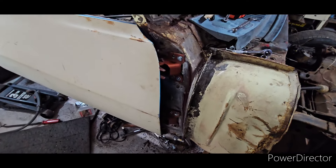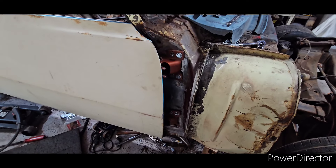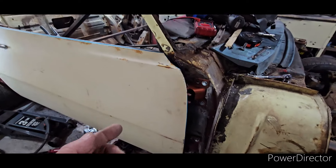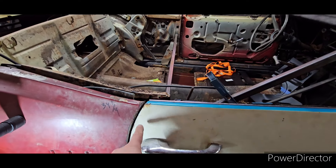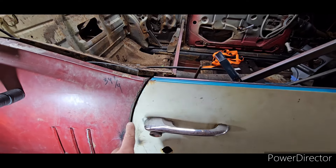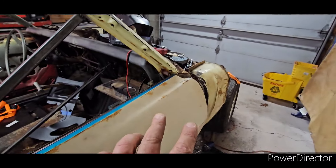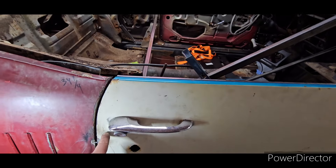Working the A-pillar door jam was a success and I'm really excited. I was able to put in the hinges Jonathan gave me and move the door forward. The height is not bad at all, the gap is great, and the door still needs to come out a little flatter to line up with the quarter panel — but I can work that in the future. I just needed to know if I could fix the A-pillar or had to cut it off. Thanks to the slide hammer and hammer and dolly work, it came out great.